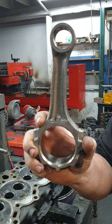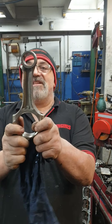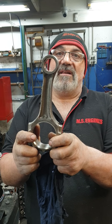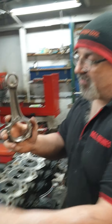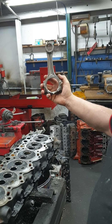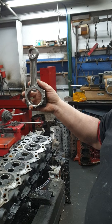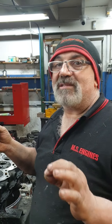What do you reckon happened here, Sam? You know what this is? It's a bent conrod — out of a diesel 1HZ. Why did this happen, you reckon? What will cause a conrod to bend? It would have hit something. No. This is a proper forged rod, a factory forged rod. The only thing that can bend it — air is not going to bend it — it's hydraulic. So either fuel or water.